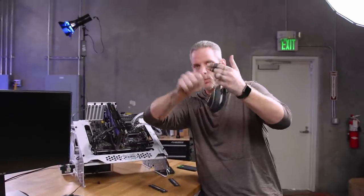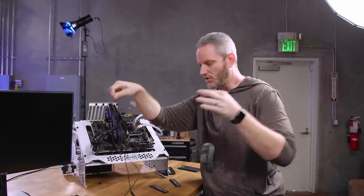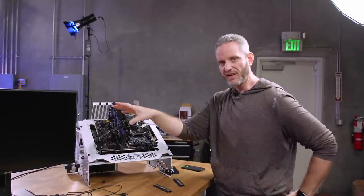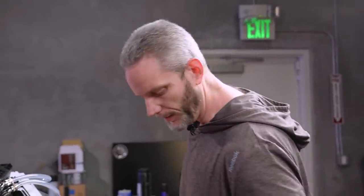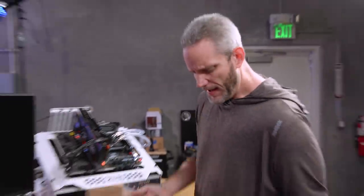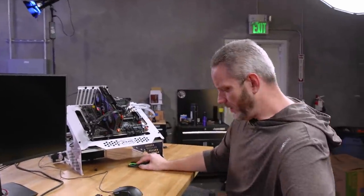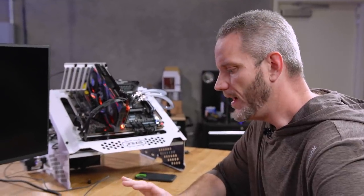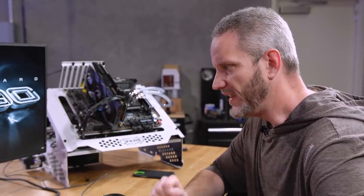We've had this cheap cord, and if there's some sort of a short in the cord, maybe when it initializes the USB it works inside the BIOS — but who knows. In the order of simple possible solutions, we should have started here with the peripherals. I once had a mouse on Skunkworks that would make it take about 45 extra seconds to boot.